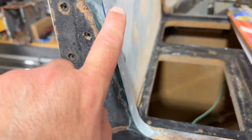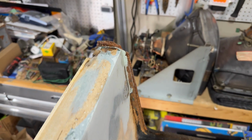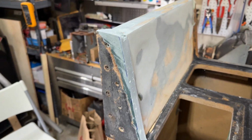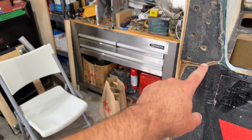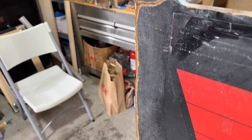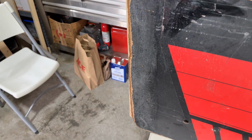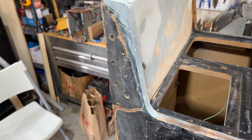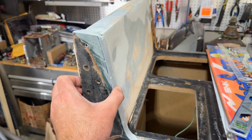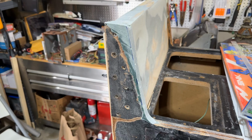We got some little pitting we're gonna have to fill in. I have to build up the tip of the toe just a little bit, and obviously it needs to be repaired over here, but that's not bad at all. So I'm gonna go ahead and do that with Bondo glass, and I'll probably use regular Bondo, filling in the edges of the bottom on both sides, and we'll hit that with black spray paint after sanding the Bondo down. But yeah, I'm really, really happy with how this is turning out. I had been putting this off for a while, so I was a little bit nervous about doing it, but this thing is nice and secure, and I think once we get it done, it's going to be looking real nice.